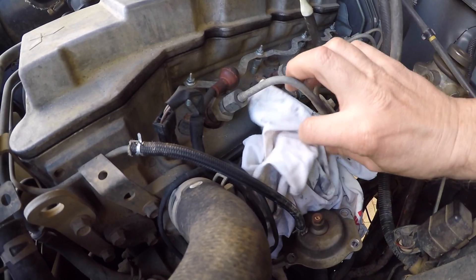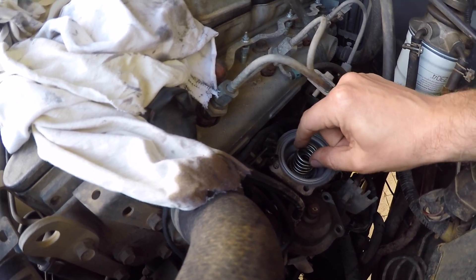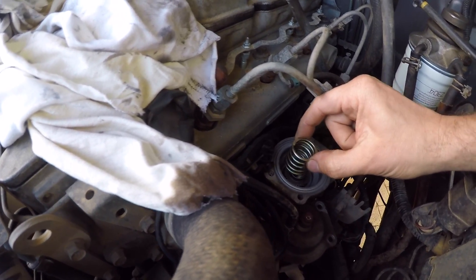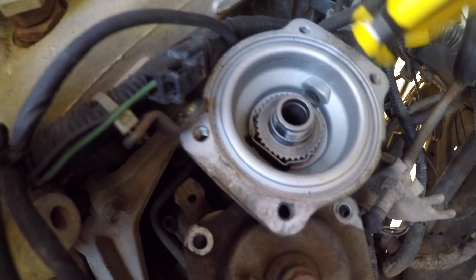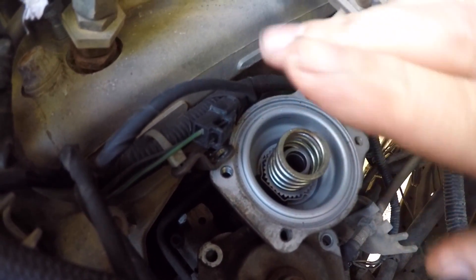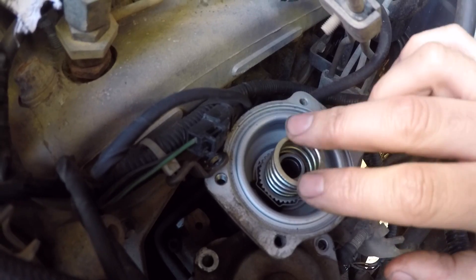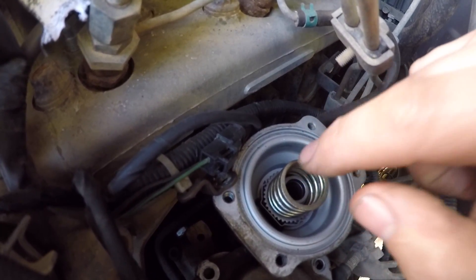The other thing that's adjustable is the spring that actually pushes the diaphragm up and down. The tension on that is preset by the dimensions of the spring, but the seat here is adjustable. This star wheel you can move around to give more spring tension or less spring tension. Again I'm not going to mess with that — if I'd swapped the turbo out for something different I might play around with it. A hard spring tension won't drop down until a decent amount of boost is on there; a soft spring tension means with a little bit of boost it's going to drop in. I'm just going to leave that at the factory settings.